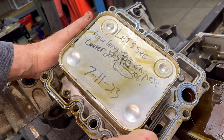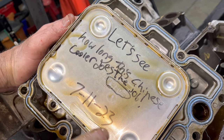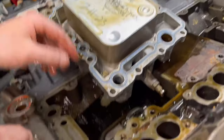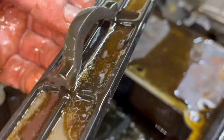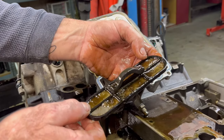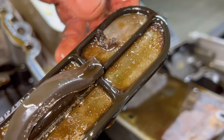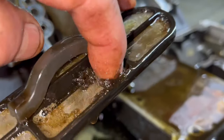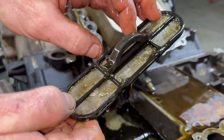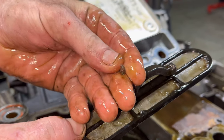They left us a little note: how long does this Chinese cooler do the job? Made in China — it is a Dorman oil cooler, 7-11 to 23. And when we look down in here at the oil cooler screen, this tells you that they used cloth inside of here and did not clean it out. That is fuzz like a son of a gun — lint. If one of these little window-pane screens would have broke out, we would have lost an IPR valve. All that would have got into the IPR valve — looks like cat hair. You can use a towel inside of this housing, but you better blow it out, brake-clean it, get all of it out. That was in there — that is a shop towel. If I put enough of that together, I could wipe something off with it.